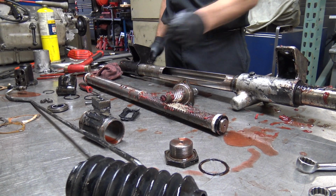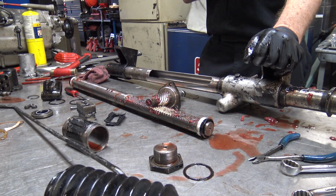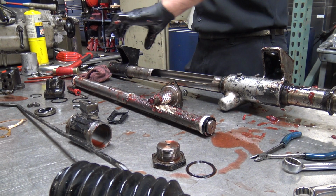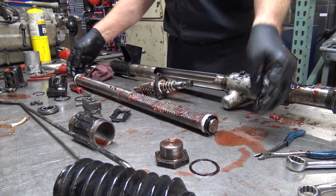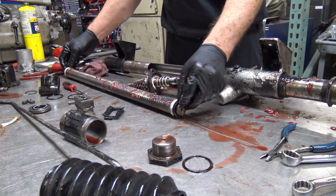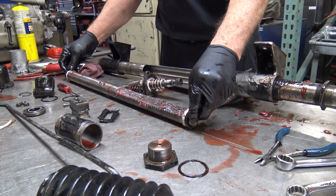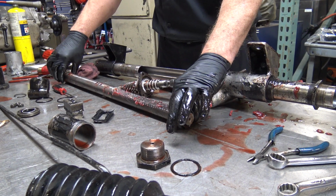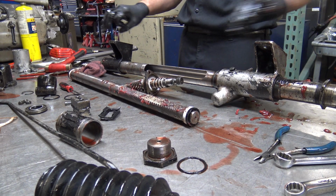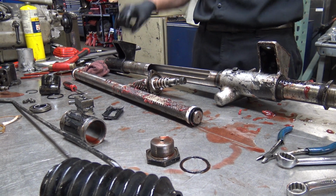When it's seized, and they try pounding it off or twisting it off, this tube twists and distorts. When this is sliding back and forth, you can see it's got a lip seal facing out here, and it's also got these PTFE, they're like a bearing. What those bearings do is slide real nice in that tube, but they keep it from shifting.